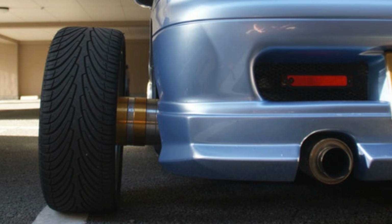The reason I bought two sets is I'm worried that it might look too wide. I want the flush look of the wheel and the fender. You guys know what I mean, right? But I do not want the whole wheel poking out of the fender. I think it will look very odd, and it might actually rub the tire, and that's not something we want. So for today's episode, we'll be trying out the 20mm and taking out the 12mm.